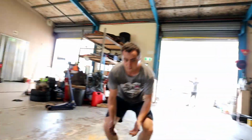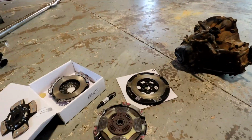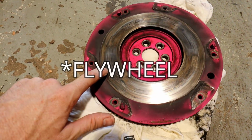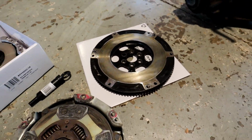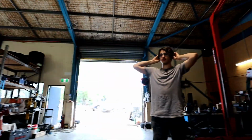And if we're going to turn this like, what, 8,500? I think we're going to have to because of the turbo, spoiler alert. But if we're going to turn this like 8,500, I don't want to do that with a stock clutch because this will definitely chop the passenger's legs off if it comes out. I think it's a good idea. We'll put this Extreme light flywheel back in there so we can actually crank some RPM. If we need to turn this to 9,000 to make power, we can do it.